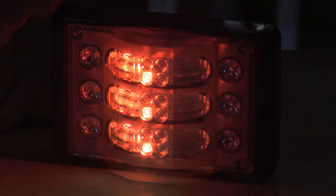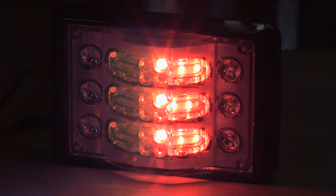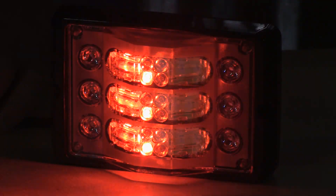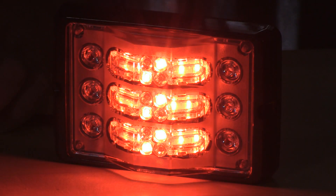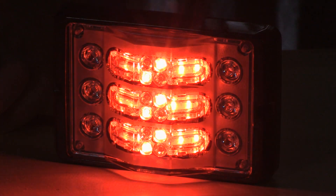Here's a nice way to look at this and how it can be split up — thinking about side mounting it on the vehicle, a neat way to separate it and grab attention around the side profile and around the front. Primarily front-facing or rear-facing, the solid flashing is going to be a better option. Now talking over to the other trigger wires: there's a trigger wire in red — that is mode one — and a trigger wire in white — that's mode two. So flashing the red only, you go through the same flash patterns by momentarily tapping the blue to ground to make adjustments. The takedown is steady burn only — there's no flashing option built into that.